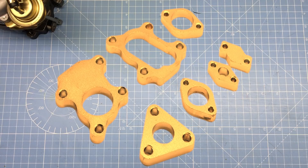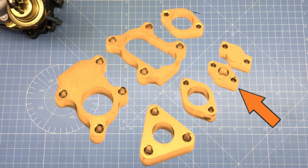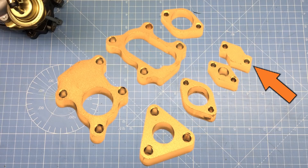So let's do a quick rundown. This guy is the flange that the engine exhaust goes to, and this one is where the exhaust exits. Actually, I'm not sure what this one's for — perhaps another type of exit flange? Anyway, this and this: one is for the air intake and the other one is for the air output, or boost. This one's for the oil in, and this one covers the water jacket. So the water jacket cover needs to be modified with an input and output nipple, and we're going to get into all that when we set up the turbo.